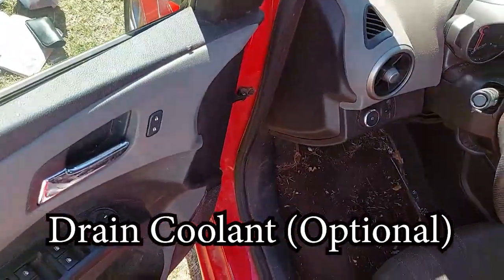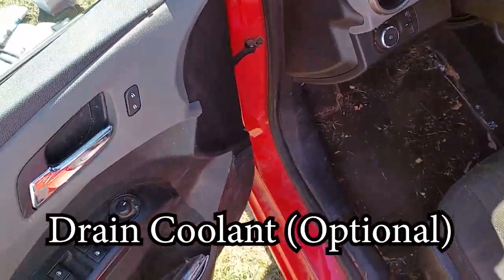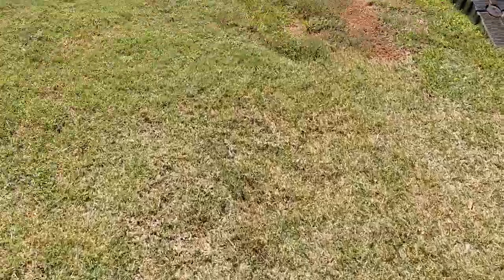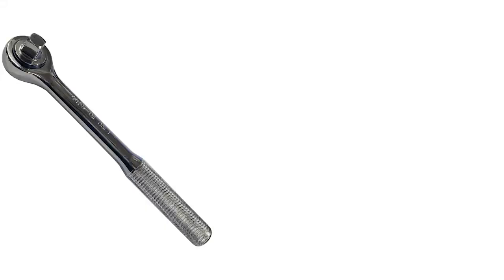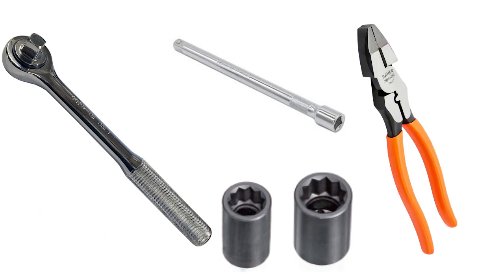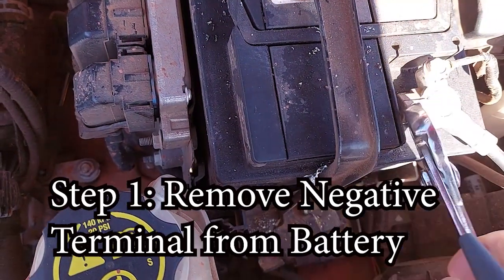You might want to put the vehicle on ramps beforehand because some coolant will be leaking, unless you drain it first — you'll still want to raise it a bit to drain it. I did not drain mine, but you can do that for a much cleaner job. Either way you're going to lose some coolant and have to replace it at the end. Tools you'll need: a regular ratchet with a 10 millimeter and 8 millimeter socket, an extension — which I didn't have and you'll see the problem — and some kind of swivel or flexible ratchet. Mainly 8 millimeter, but also 10 millimeter, and some pliers to help get the hoses and clips off.